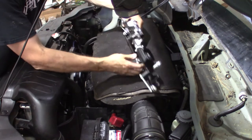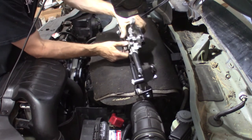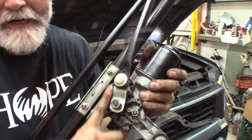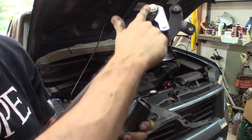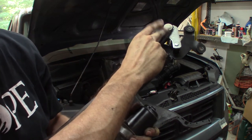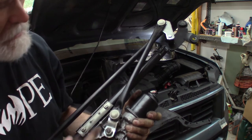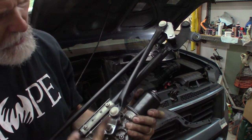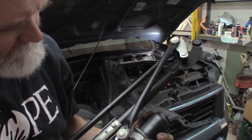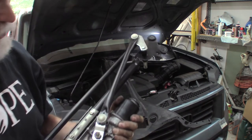I wanted to show you this. I'm going to move this arm — line it up, there we go. The arm on the back of the motor — you can see on that arm that it connects to: it's a straight line, all the way straight. It's facing that arm and pushed as far as it'll go towards the passenger side. This is parked right now, so I know it's at its lowest point on the window — that's what you want to line back up. Once you know it's parked, you want it that way. When they turn it on, the first thing it's going to do is pick the arm up. If you don't get this lined up straight when you put it back together, you're going to have a problem and you'll have to pull it apart and reset it.